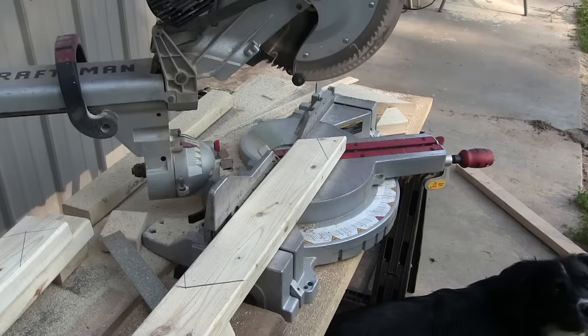The first thing you'll notice with camper siding versus regular house siding is you start at the top. You staple it all the way across the top, hold it flat so it doesn't have any bubbles, and staple the bottom side. The next piece below slides up into a channel on the upper sheet, then you staple the bottom side of that sheet. I was told to use wide crown staples but couldn't find a wide crown staple gun in town, so I'm using narrow crown staples, one inch long, putting about three or four on each stud. Make sure your siding sheets go all the way to the ends of your camper, and the sheets coming up from the other direction go right to the siding you've already put on. That way your corner joint is really small and easy to cover with putty tape.